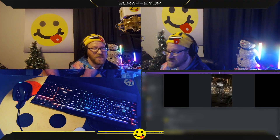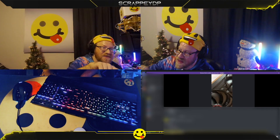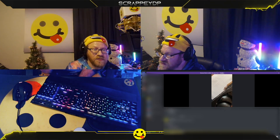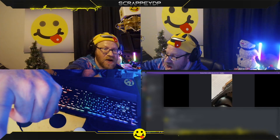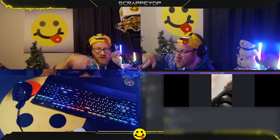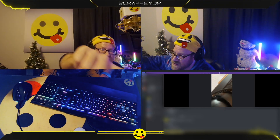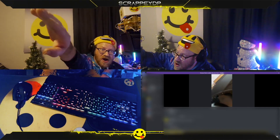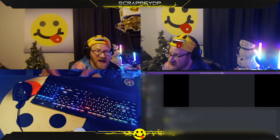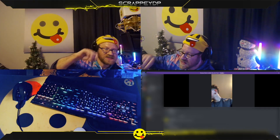Now you know what that tab is made for. Go look back at your GPU — look at the very end past the pins. See that hockey stick shape right there? It's got a little label on it. That tab locks up over that little hockey stick. When you push it down you're releasing it — then the only thing holding it is the friction of the pins. All those copper pins along there — the hockey stick has no pins on it, but the other part has probably a couple hundred pins friction-fitting into your PCIe slot. The PCIe x1 or x4 slots have no actual tab on them.